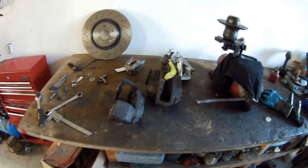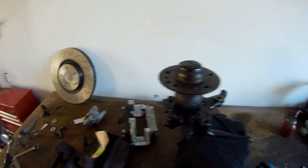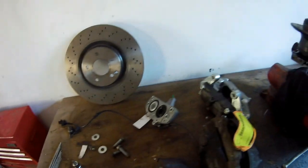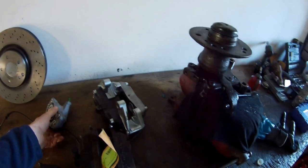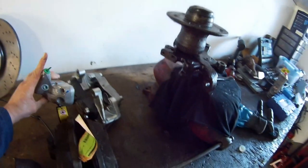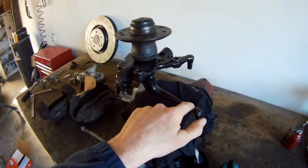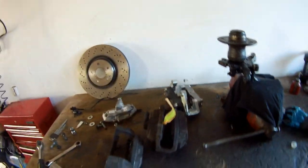If you look at the products, in the last video I did new wheel bearings in the hub. I'm using a front disc of 335mm, 28mm thick, you can see it's a Brembo disc. I have the caliper, this one is already changed, but normally you have a connection on it. That's normally on there, and the problem is this connection is too long and it will hit the arm on the hub where your steering arm is connected. That's the biggest problem. So what is the solution?